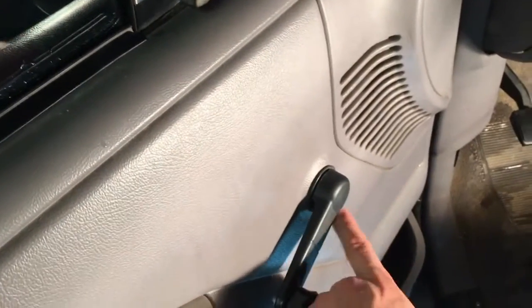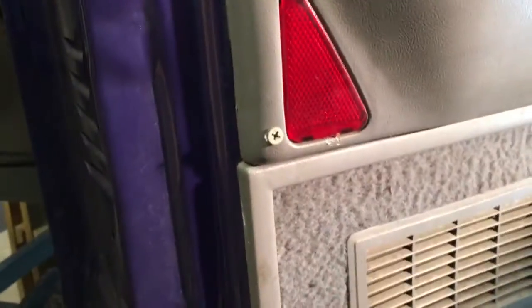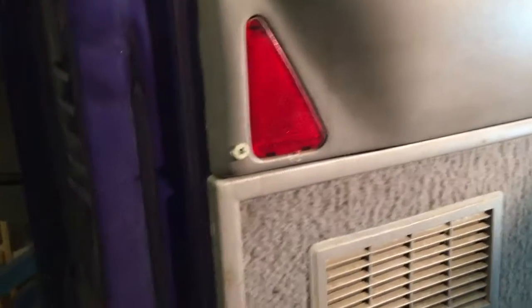Behind my roll windows there's going to be a screw, and you've got different screws and fasteners here and here. The previous owner wasn't much for OE fasteners, so he used screws to screw on the door panel — I've removed most of those and gone back to the old snaps. Something you should know about pulling door panels off is typically they aren't all screwed on. They're snap-fastened, and on the back of the door panel there's a little snap that expands and holds the panel in.